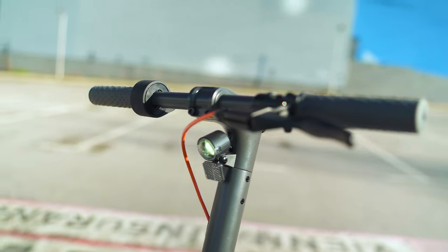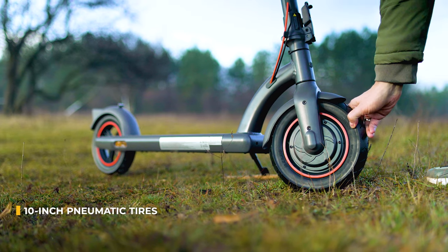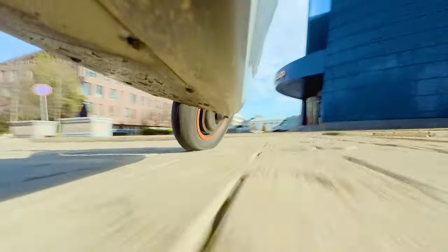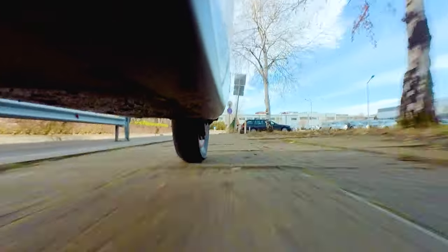The tires are another critical component and they're also on the good side. Here we have 10-inch pneumatic tires. Unfortunately they're not tubeless and not filled with sealant, but they're fantastic at absorbing small bumps because of their overall thick size. This seems typical for Navi Tech, as the N65 uses a similar approach and is among the scooters that — even without suspension — delivers one of the smoothest riding experiences. I share the same opinion about the Navi N40.